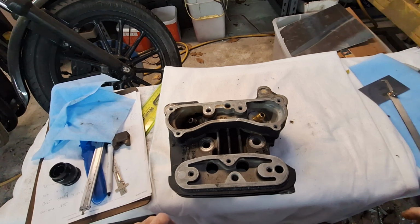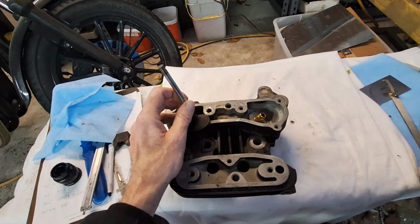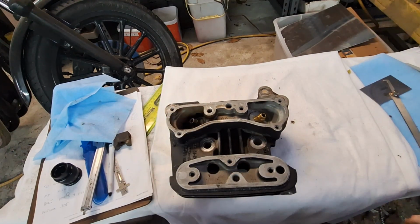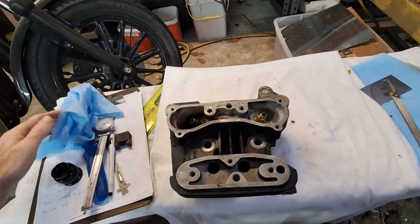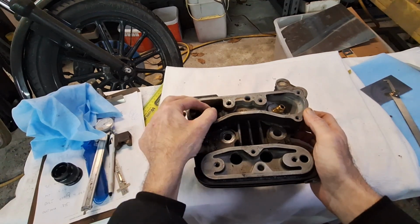Well, as an example, like the XR750, which is a great motor. Dick O'Brien came up with that thing, and it worked. It had smaller valve sizes. Valves were canted in a lot closer, and what was on especially an Ironhead, 45 degrees, you're losing a lot of power through bad port design and rocker arm side loading the valves. So anytime you're side loading something like that, you're losing power. But as far as Harley goes, you're stuck with what you're stuck with.